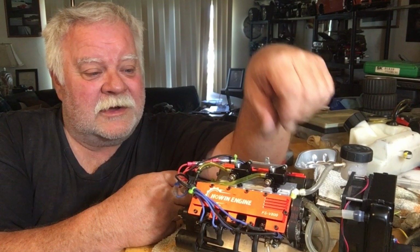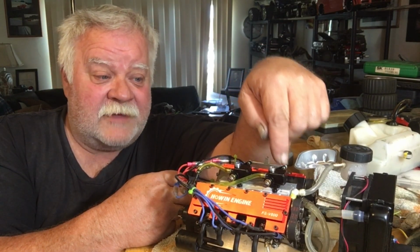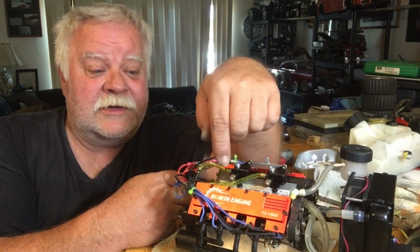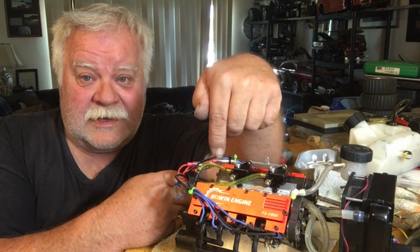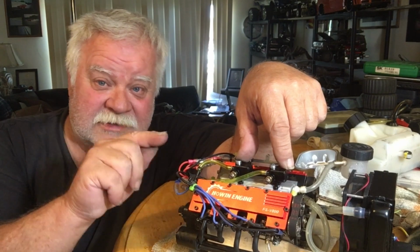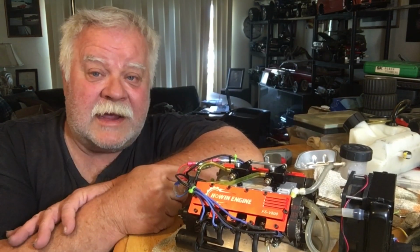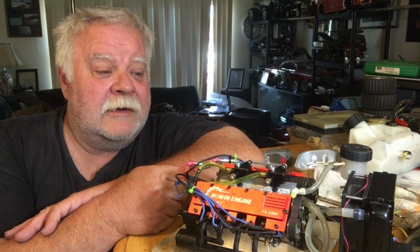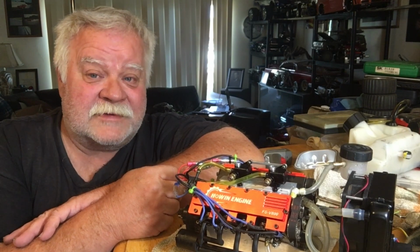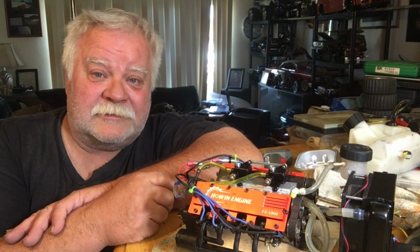So, long story short, let me do a comparison. The first video that I'm going to put up is the way it was stock. In the second video, you'll see the aluminum intake now, because I bead blasted it, and then I chamfered all the edges, made sure it was clean inside, and I probably could polish the ports inside to get a little bit more out of it, but we'll see what happens. Right now, I'm really happy with the way this thing revs up. So anyways, guys, check it out, and I'll be back.